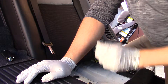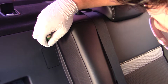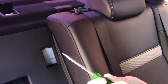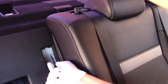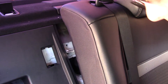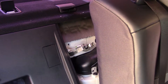Now that you've removed those two bolts, take your small screwdriver or your fingers and drop that down. Use your screwdriver, push it inside this little ring and slide it to the left. Hopefully you heard that pop — that means the backrest is now able to come down. You can put this screwdriver back since you won't be using it again.